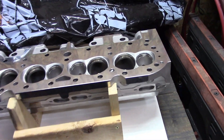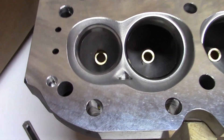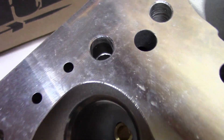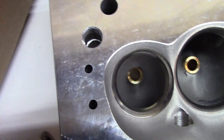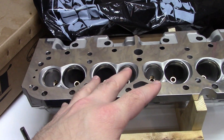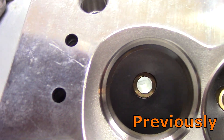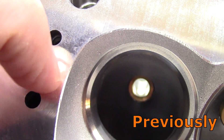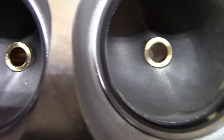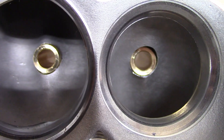Anyways, let's look at the head. You can see right here — there's that chip in the hole. Right here is a scratch on the deck. Lighting is a little different in here, so let me get a better angle. There we go. I'll pull off the clips from the other video and we'll compare them. Here in a coolant port, a chip. The biggest defect I found was this scratch right here on the deck — and it catches my nail. You can see down in here, there is oil on the guides from when I checked the seats.